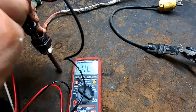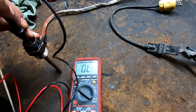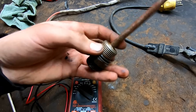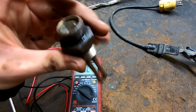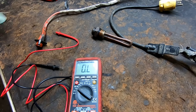I'm just touching the tops of those two prongs right now and - nothing. We've just confirmed that this is a broken circuit, so this is the issue with this truck. The new one should be here any second and I'll show you the new one, test the resistance on it, and that'll be pretty much it. I'm going to throw it in but won't bother showing the installation since it's going to be different for whatever vehicle you're working on.